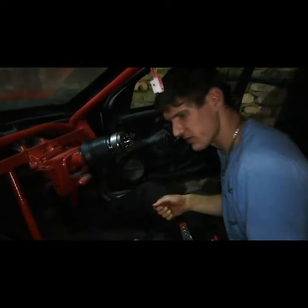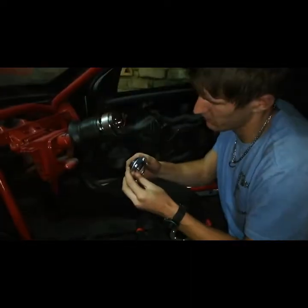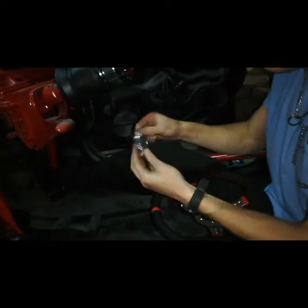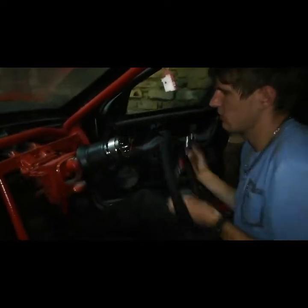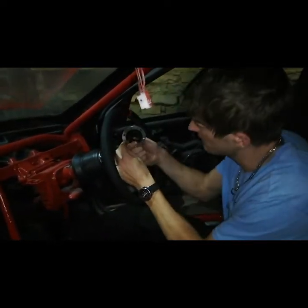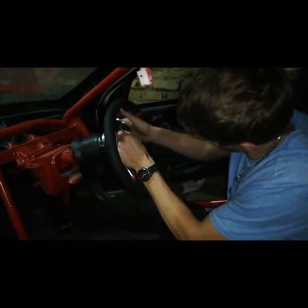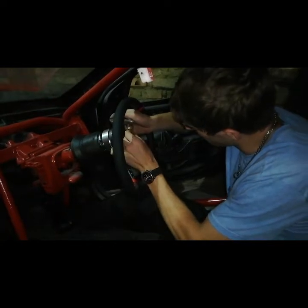So now what we're gonna do - this piece here, if you press it, it fuses the two contacts together and that activates your horn. I'm just gonna put it in there and fit it straight. Then from there, put this up and attach it. I don't really think it matters if it's positive or negative, because when you press it, it connects them together.